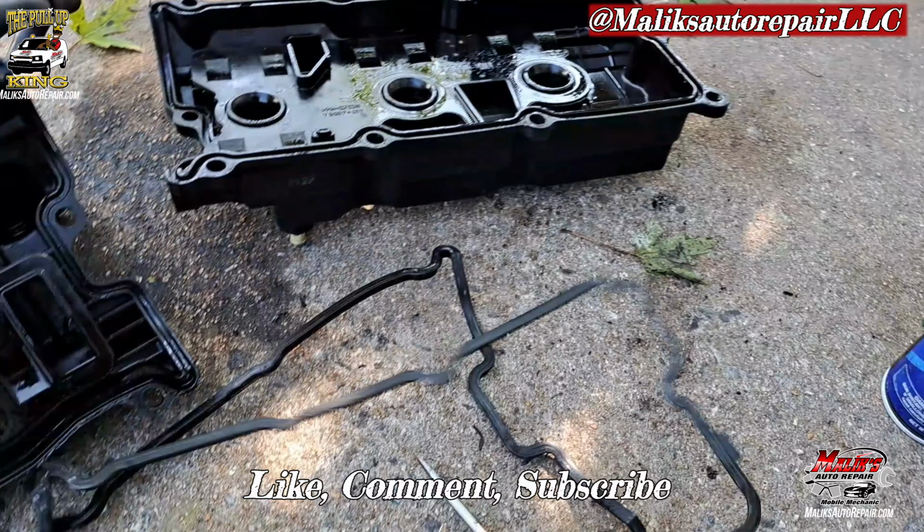10 mils, one, two. Just gonna get that off of the manifold. Another 10 mil, pull that off. This hose right here goes here. Pull that off. Harness undone. Throttle body. Coolant line. Take that out. That connects back here. Can't really get up in there to take that out, so take it out from here. A little coolant is gonna come out.